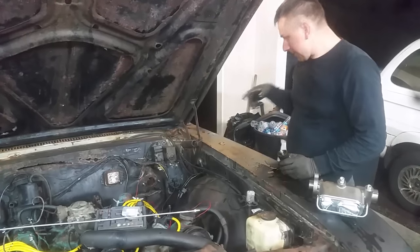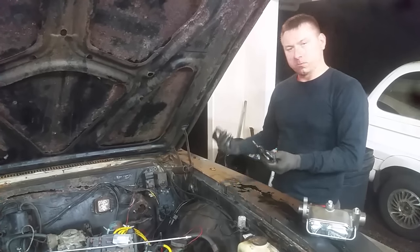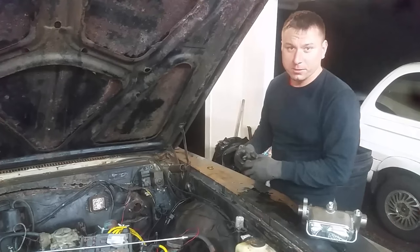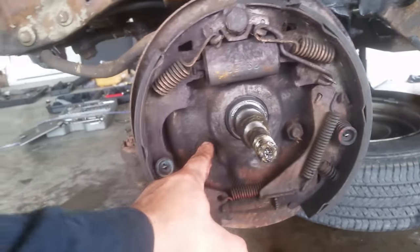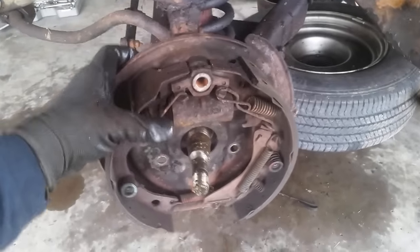Trying to pull the master cylinder off the firewall without just unscrewing it is an absolute nightmare — don't even try it. So just reach under the dash, unscrew it, pull the whole thing off, and then pull out the little clip, and it all just comes apart. The whole thing just slides off. Don't try to do the springs, none of that. These two nuts and this anchor bolt, and then the whole thing will just come off. If you undo the hose, that's all you got to do — it's a one-piece assembly.